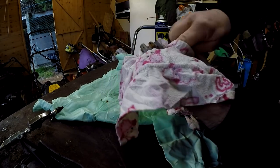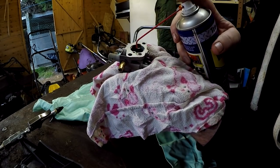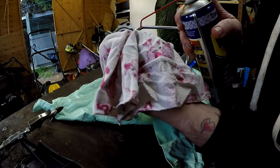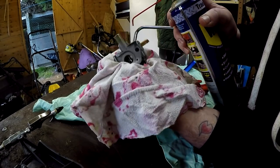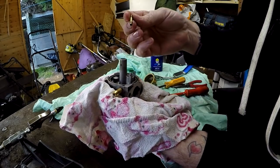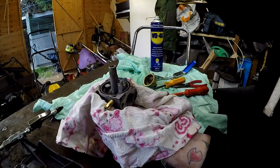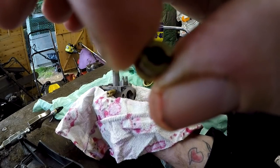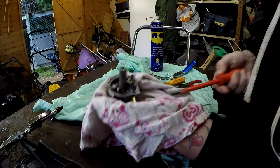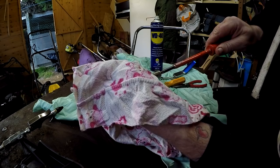This carburettor should run hopefully. That runs lovely through there and it does through there as well. Tube backing in. Main jet goes in now - you should be able to see some nice daylight through there. There's daylight through it - I can see it, nice big gap in there now. And that's the only problem with this one - stale fuel. Do that up well seated.